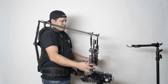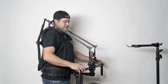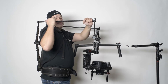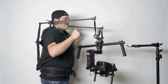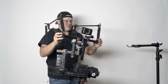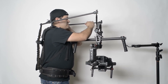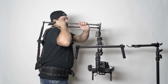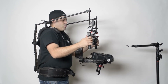First thing I do is check the tension. As you can see here, there's not enough tension — it's sitting way too low. Hold it, push back in, let go and see where it is, then tighten it there. Now this one has more tension and this one has less, so it's sitting off to one side. Adjust the one with less by going in a little bit. Now this one has too much, so go out a little. There we go.